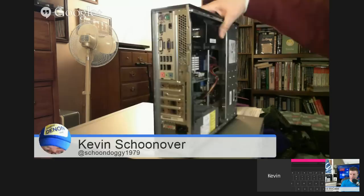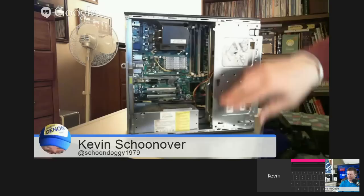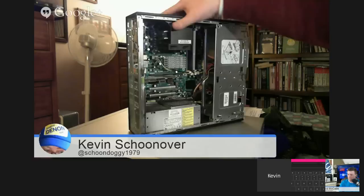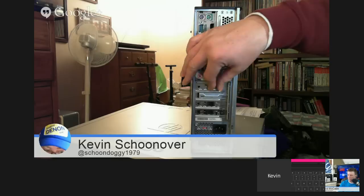So this guy will ultimately be for my firewall, as I'm moving to Sophos. I popped in cards, so the onboard gigabit will be the management port. The first gigabit Ethernet card here, a cheapie because it's a standard old PCI, I think I had some lying around, will be the incoming from my cable modem. This will be my DMZ out. And then there's a dual port Ethernet card that I found very cheap because it's fiber connections. One will be the production for the house, the other will be the lab connection.